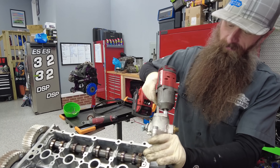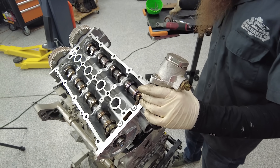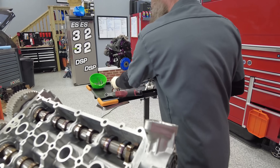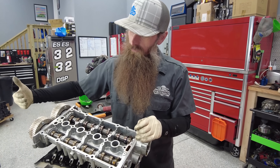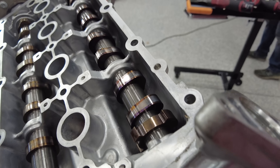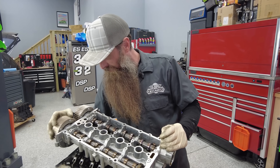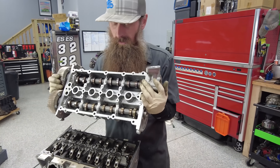This is a really weird design, and I actually think this is the only engine that Volkswagen does this with. The 2.5 out of the TTRS is a similar design, but this girdle here actually bolts on - this looks like it's all integrated. Let's go ahead and get our high pressure fuel pump off. This is a very similar high pressure pump to what most of the VW Audi family uses. I think this one has a roller rocker style like the newer chain-driven ones. My guess is the camshaft is probably slid in without any lobes on, and as it goes through into each spot the lobes are slid in, everything's pretty hot, and then once it cools down it's probably seated in place. If you ever had a camshaft problem, you're getting a whole unit anyway.